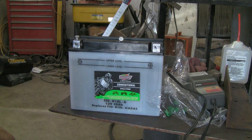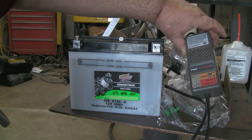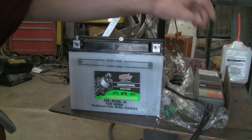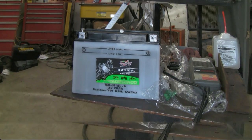Another thing you must do is charge it before you put it in service. I use one of these little automatic chargers, only one to two amps. I left it on overnight because it's an automatic one — it brings it up and goes into a test mode to see if it's good. Charging it correctly with a low amperage, not your 10 or 20 amp charger, will really extend the effective life.